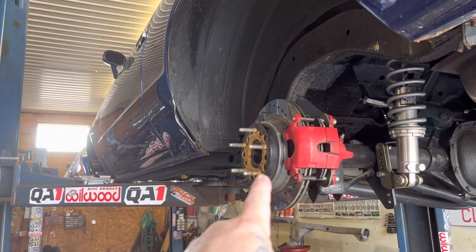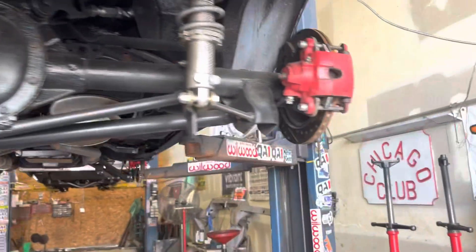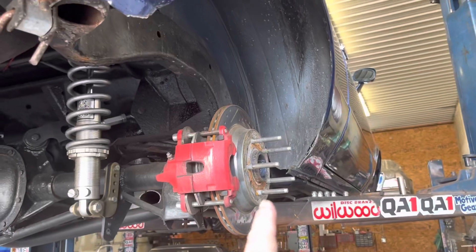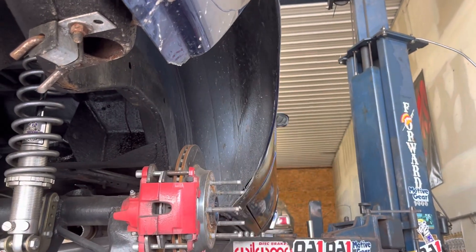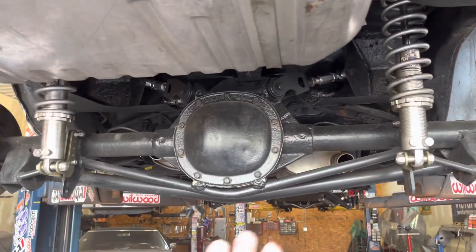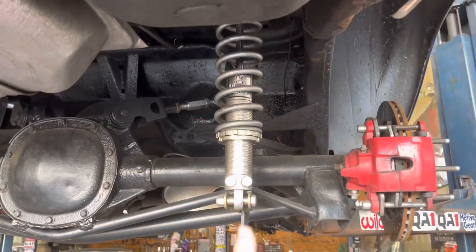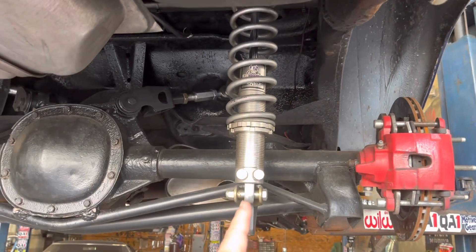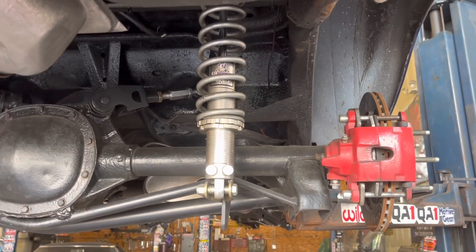You can see I'm riding a three-quarter spacer on this side and no spacer on the other side, to keep both wheels exactly with the body because the body is pushed that way. Everything on the rear end is built square to the frame - so why would you put the brackets on the housing an inch and a half over to correct it?